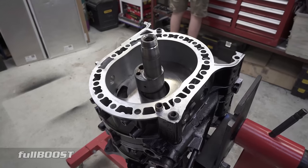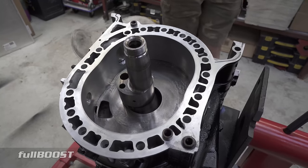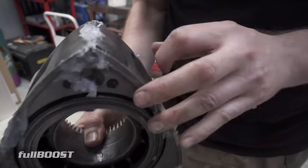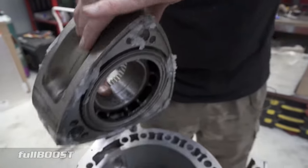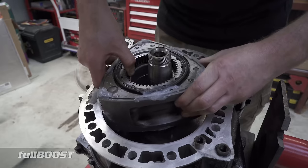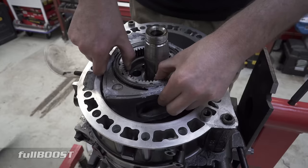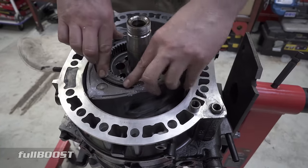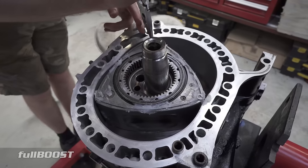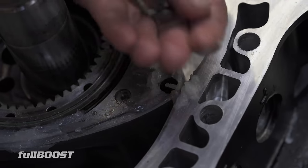That's all in place — no pinched O-rings, it's great. Now we drop the rotor in. The gear side is up this time because the gear will be on the rear. We'll just put it in now. Just like before, there is only one possible way that this can go on. Put it back and forward and down it sits. Next step is exactly what we did on the front rotor — taking out the corner seals and putting the apex seal springs in.